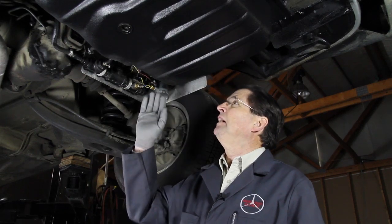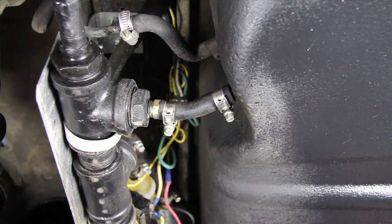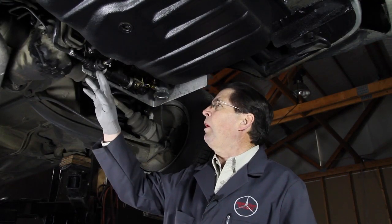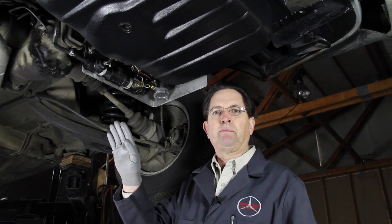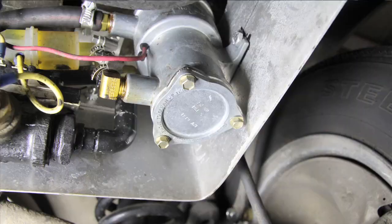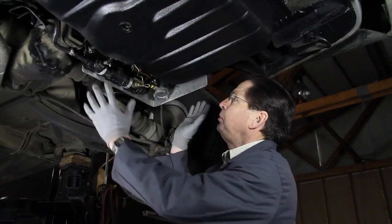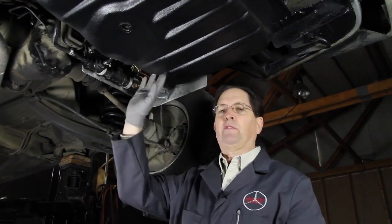In the back end, I have the fuel come out of the tank directly into a cast iron sump, and this sump is heated by a diesel glow plug and controlled by a thermostat. So when I turn the key on, the oil will immediately start warming up in the sump even before I start the engine. What I feel is a real key to all SVO conversions is an electric fuel boost pump at the back end to help push the fuel up to the engine. Here you can see I've put this all together on a mounting plate right underneath and just forward of the factory fuel tank.